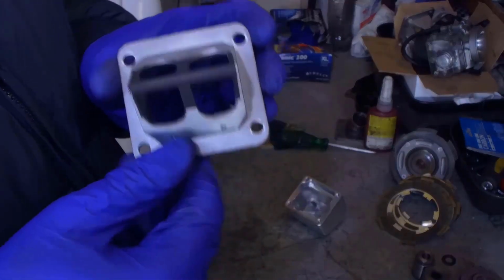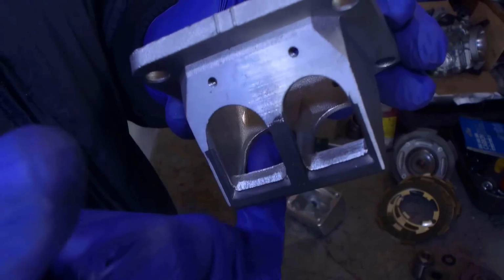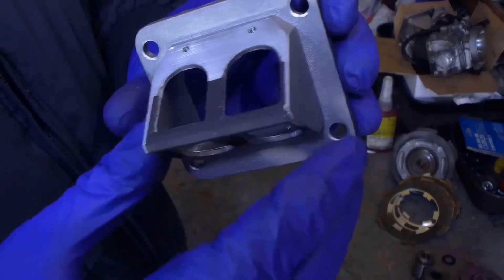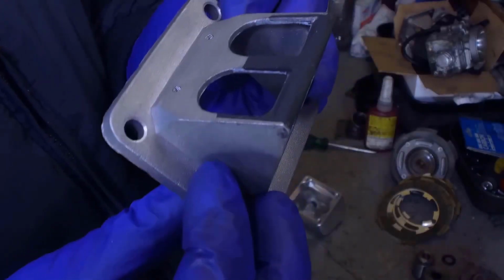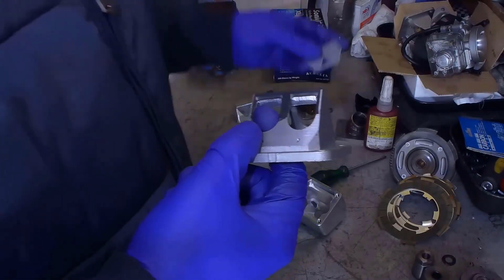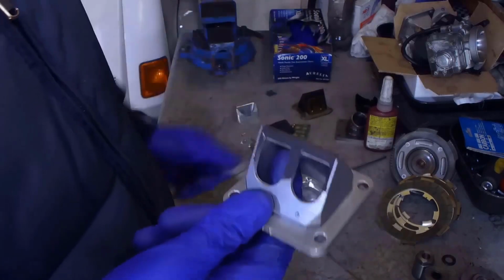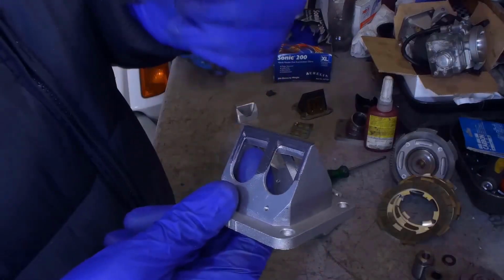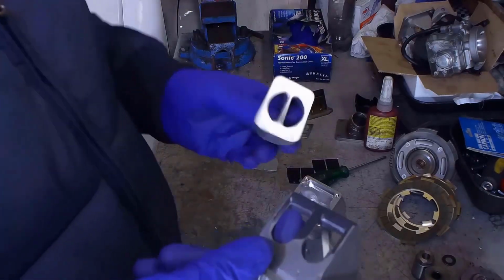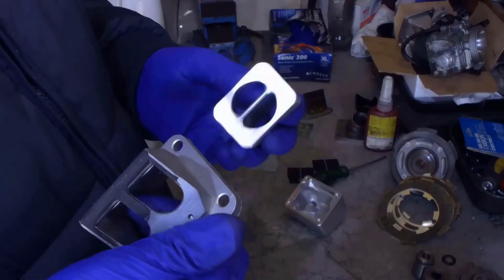I've already cleaned all the internal fusion burrs, which are located in this area, unplugged the original reeds, and prepared it for the installation of new carbon ones, and also a flow guide. Originally, this reed valve pack comes with some 0.5mm fiberglass reeds. They're not very high performing though, so I replaced them with a carbon reed kit from MRP, along with a flow guide to insert in the cusp, with a 30mm diameter like our collector.